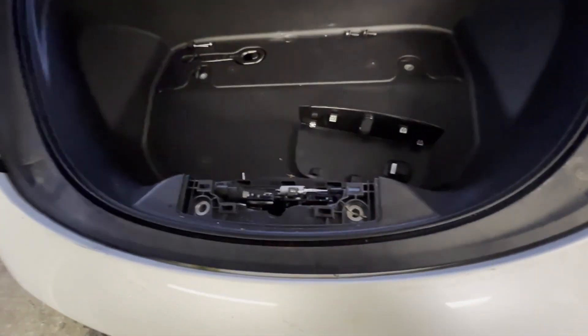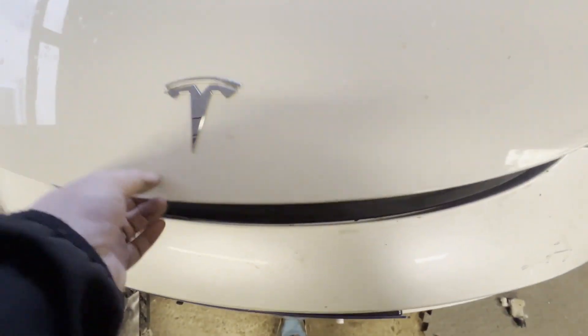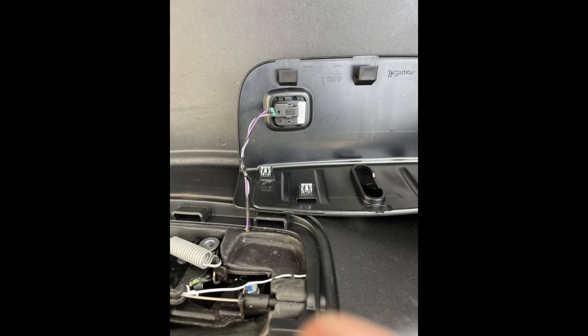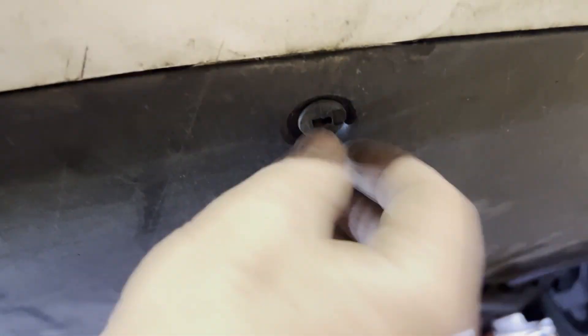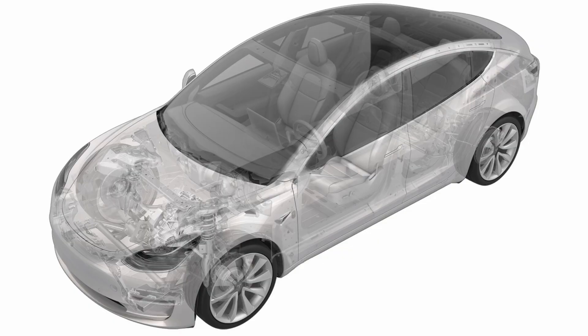When putting the frunk back together, make sure to reconnect the wire for the interior light and release button. When fitting the under-tray clips, pop them in first and give them a bit of a twist so they lock into place properly rather than springing out. To finish, it's mostly a case of putting everything back as you found it — the 10mm bolts may be a little awkward but everything else should just pop back into place. Hopefully that helped — feel free to like and subscribe if you enjoy these videos.